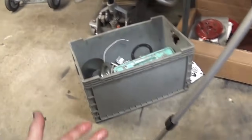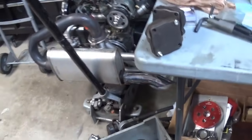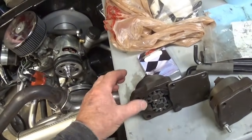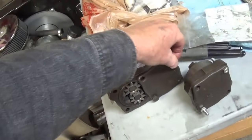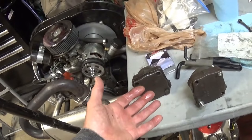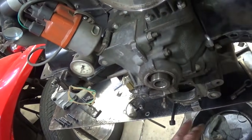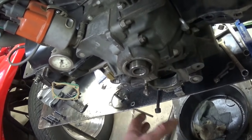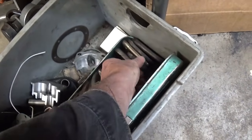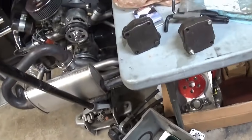So I started looking at my oil pumps. I've got all these pumps collected over the years. I've got some Melling pumps - probably one of the finest oil pumps around, they make them for all types of cars, cast steel, tough and well-made. The problem being the expansion rate won't be consistent: the factory pump was aluminum, the case is aluminum, and that's how they kept it from leaking. As they get old, you're going to have leaks.